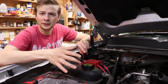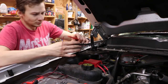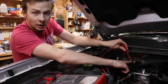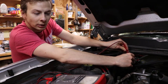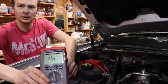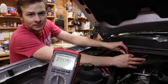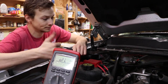Another test specific to my dual battery setup: I want to make sure the solenoid is working correctly and that both batteries are indeed separated. Going between the terminal that connects to the main battery and the terminal that connects to the secondary battery, I have 2.39 mega ohms. There's a little bit of continuity, but it's in the mega ohms range, so it's high enough that it won't be drawing one battery from the other. All good there.